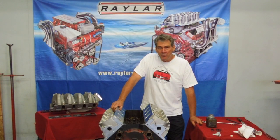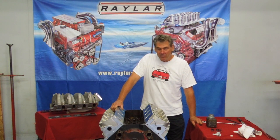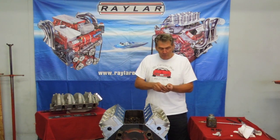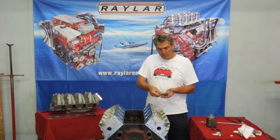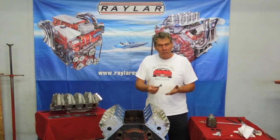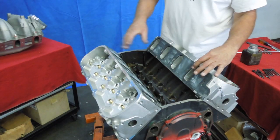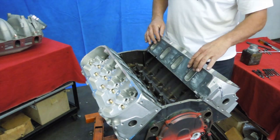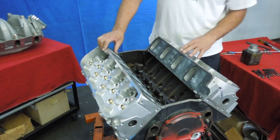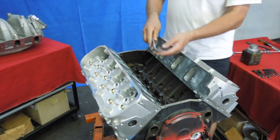In this episode, we're going to show what it takes to put an intake manifold on a 496. The bolts we're going to use are the black General Motors replacement bolts — 70 millimeter long, the replacement for the earlier bolts. For demonstration purposes, the gaskets we're using are these paper gaskets. They work really good for demonstration and actually work pretty good for assembly too, but are a little bit harder to find than the GM O-ring gaskets, which work really good.